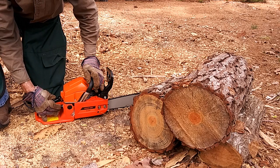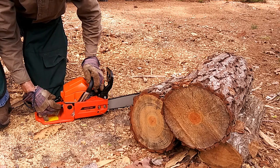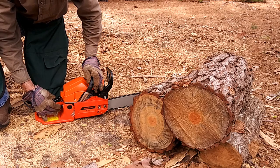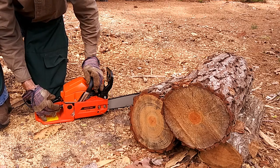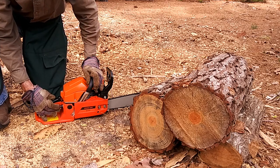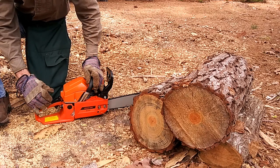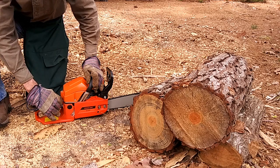We've got the fuel coming now. Once it starts coming I try not to push it too fast, because when lines get older, if you push it too fast you can actually blow them out. It's probably doing real good right about now. Just like we said before, from there when you hit that choke — now we'll hit that on/off switch.